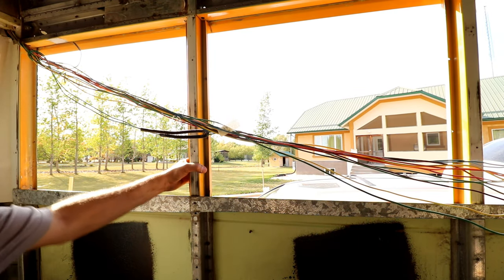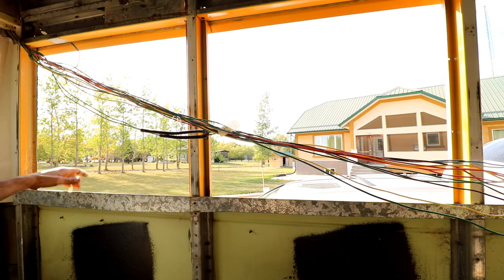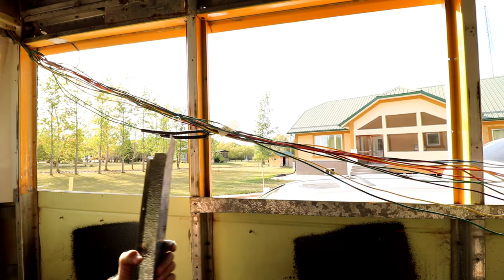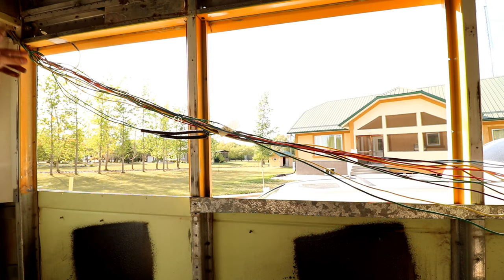Now the problem. In this window bay, I was going to chop this out, weld a piece of structural steel to here, then put in a 48 inch window. Problem is, I took out all the rivets and I was expecting this to be structurally sound — it's only 20 gauge steel. So now wherever I'm putting in a new window, I have to put in a new crossmember for the window support. I'm going to have to weld a piece from here to here first, then put in the window support. Things just got a little bit more complicated with the windows. I'll get set up for the welding — I just have to cut a piece of steel for this, cut a piece of steel for that, then I'll get the welding done. Hopefully.